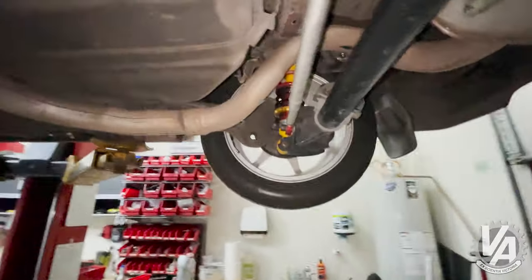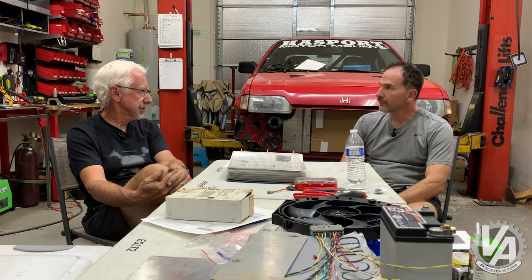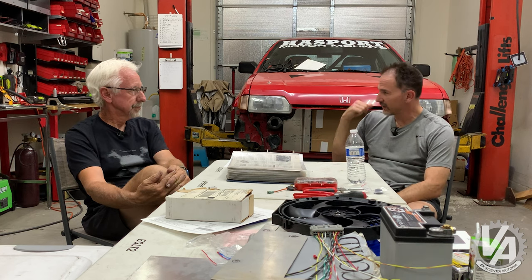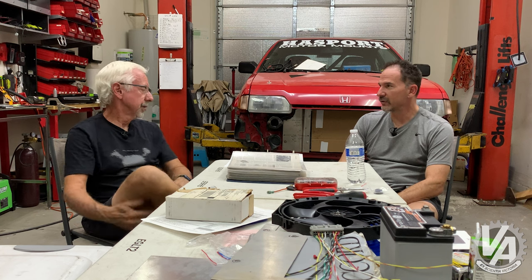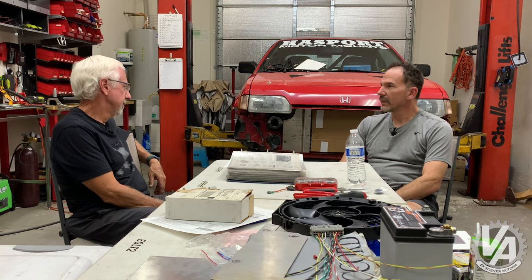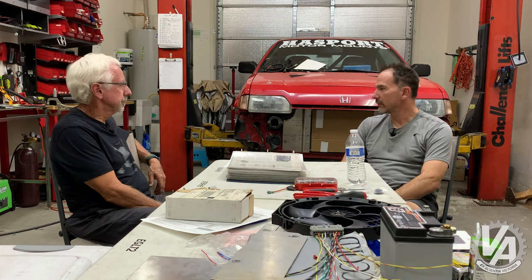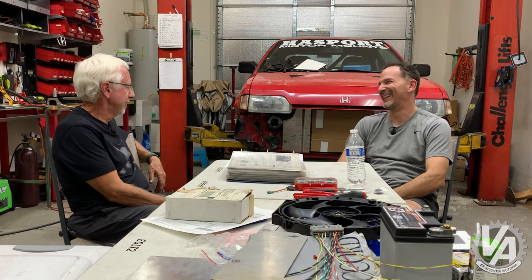As for lightening the chassis, not too much. The rear axle doesn't have the SI axle with the torsion bar inside — it's actually got an HF axle with a custom sway bar and custom torsion bar assembly, so it's got the lightweight axle back there. I have a disc conversion and a really cool trailing arm conversion sitting in the garage. Once the K-swap is done, I'm going to put those on — it'll add a little weight but also widens the back end a quarter inch on each side.